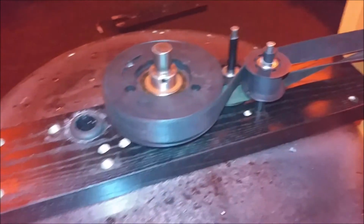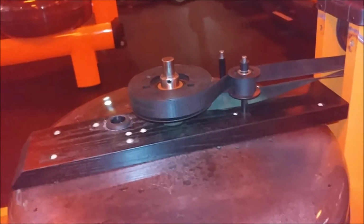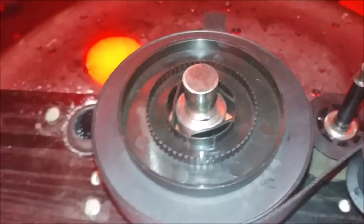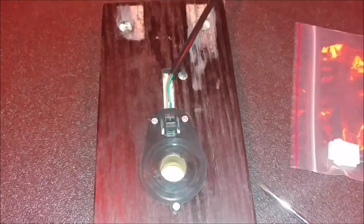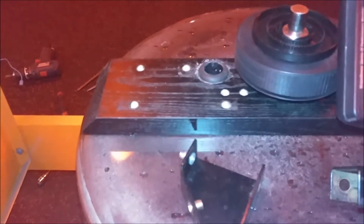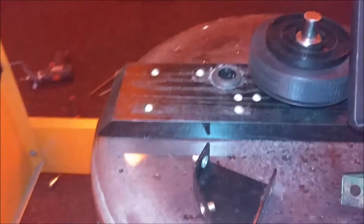We have our straps connected right and everything in position. We can go ahead and attach the top board and the sensors. The new sensor, you just slide it over the top of the pulley. Remove the old sensor and replace with the new one. Now we can reinstall the console and frame using the 4 5mm Allen key bolts. Once they're in place, we can reinstall the top board.